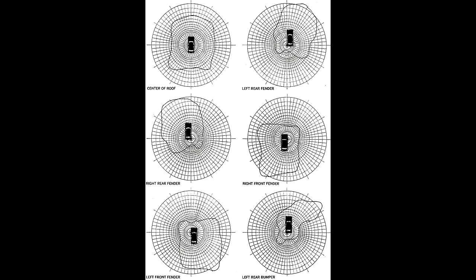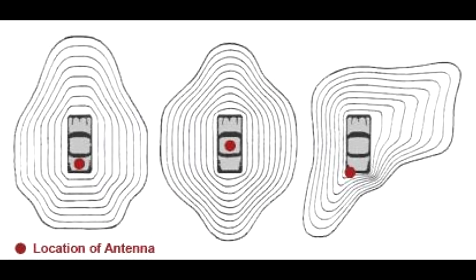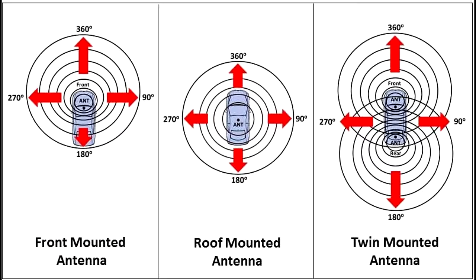When you mount an antenna at a corner of a vehicle, you're creating a directional antenna in a way. It's still going to work pretty well, but the longest range out may be directional. That radiating pattern may not be where you want. It's the same issue with co-phased antennas on truck windows — they're not far enough apart to create a perfect co-phased circular pattern. In fact, they're so close together that the radiating pattern is best in the forward and rear directions, which is actually what you want when driving. So everything's about compromise.